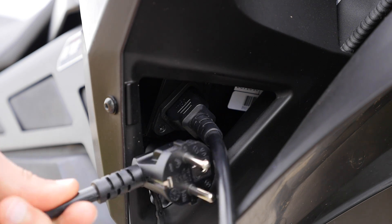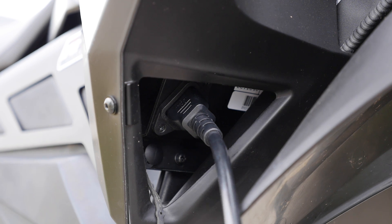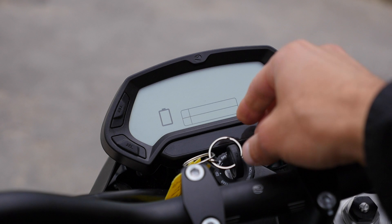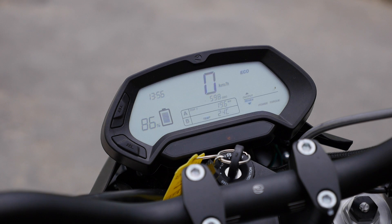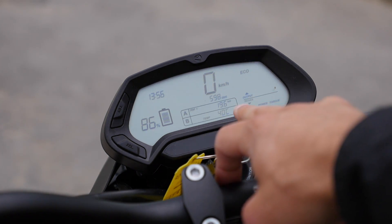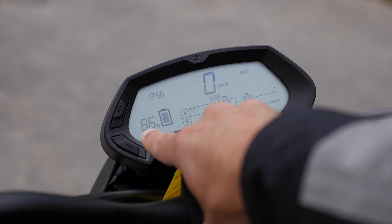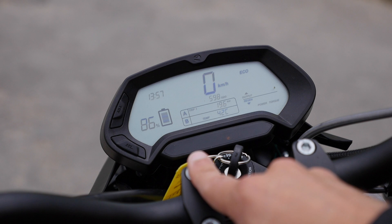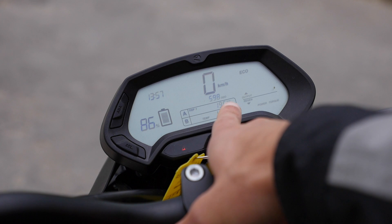Where you'd normally find the radiator, you can pull this and put in the plug — it looks like a plug from a printer or monitor. The other end would be a normal household plug. If you're really down to zero or one or two percent, it takes about nine to ten hours to recharge fully. You can turn the key on the left side as the normal lock. When turned on, you can see normal speed, temperature of the motor and battery, trip info, and how much capacity you have left. We measured a range of about 100 kilometers — almost one percent of battery equals one kilometer.